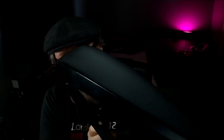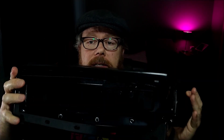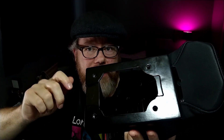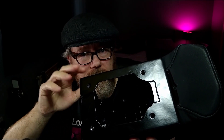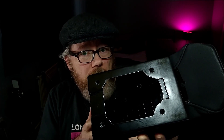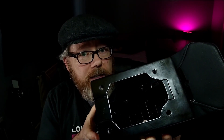Another part I've had is the Moto Seat - that's from Vector as well. Very well made, really nice. I think that was about €60-ish. That's really nice. I'll fit that on the next one because it's got four bolt holes, and the two holes at the back on the frame are very, very tight - you can hardly put the bolt through, so I'll have to do a little bit of filing. Because the frame's powder-coated and powder coating is quite thick compared to paint, I've got to do a little bit of filing on certain parts, like the dropouts for the back wheel axle.